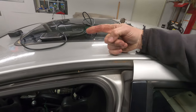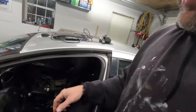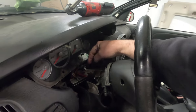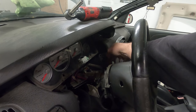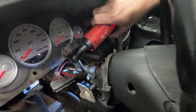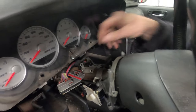Right now I think I was at the point of getting the ratchet — a quarter inch — because I need to remove the SKIM right here. I'll remove the switch and get it out of the way because that's so much easier. I already got this unplugged. I'm going to remove this and then remove our ignition cylinder with the key for this one, and I'll show you how to get that out. Let's get this out — going the right way — there we go. Now we got this off, pull this out.